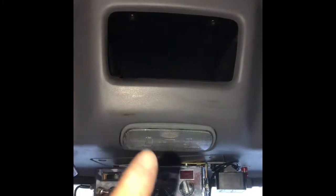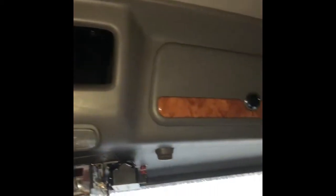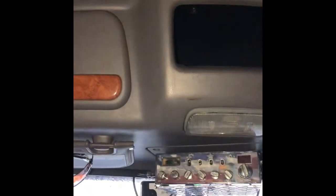To remove the front cover, all you have to do is remove both of your visor clips, two screws up there, your light, and then gently pull on the edges down here and they'll unclip on both ends. Then it just lays down — simple, easy peasy. Wish somebody had told me that before I went through the trouble I did.